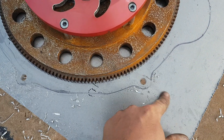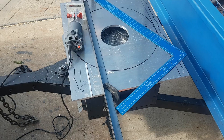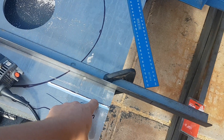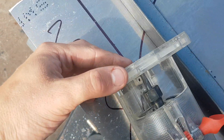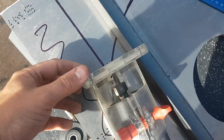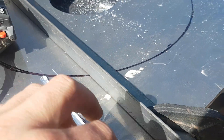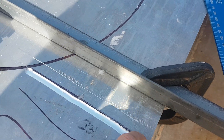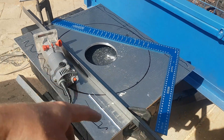Everything lined up really well so I'm quite happy with that. With my lesson with Aiden the other day I know that the router can cut the aluminium — I've just given a little test here. I know that I shouldn't cut more than half the cutter width if I'm doing a full cut. I've just poked out the end of the router a little bit and given it a test. Now I'll put the straight edge in and route along here, do the same on that end, then go a little bit deeper and make my way through the aluminium.